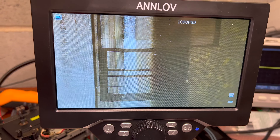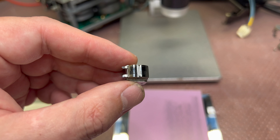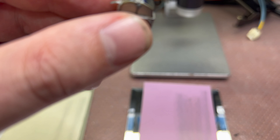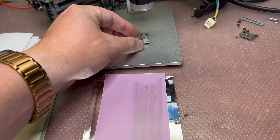I'll polish it with smaller grits and it should work pretty well. Here is how the heads look after 1 micron — I also have 0.5 and 0.1 micron. This is the record head now; I like how the gap looks. Here is the playback head and the gap is barely seen — that's a good sign. Let me keep working on it and it should come out pretty nice. It's coming much better now. Let me finish the work and I'll show you the final results.